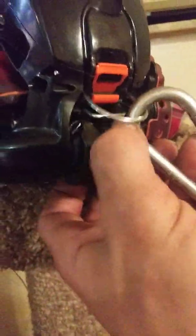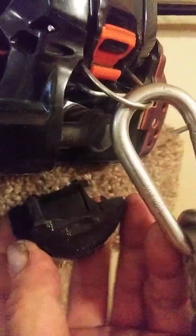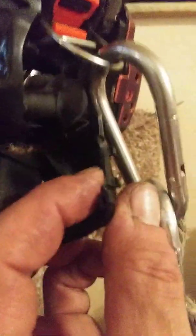One annoyance that points to quick craftsmanship: the spark plug door, just like the air filter door, is a smart little snap-in on little hinges. The problem is that when you open and close it, the top inside of the door nails against the top corner of your spark plug, roughing it up every time. It only takes ten seconds with a grinder to give it the clearance necessary, put it back on, and the problem is solved. I really feel like they should have caught that before it left the factory.